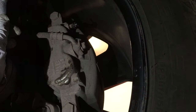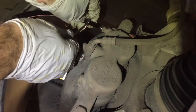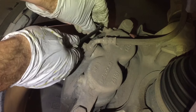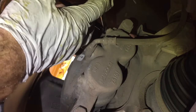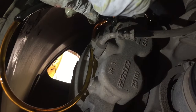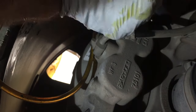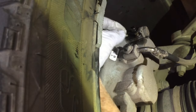See how easy that was. We'll just move over to the driver side front. This is the driver front wheel from the inside — once again we just crawled under the vehicle since it's already high enough up. We go ahead and put on our wrench and our tube. Our tube is in place, just laying our 10mm wrench right over that, and we have our bottle now higher up. She's holding the pedal — we go ahead and open and close. Some good bubbles came out that time. Go ahead and pump three times — hold — open and close. Once again, same process. We finished it up and put our cap back on.